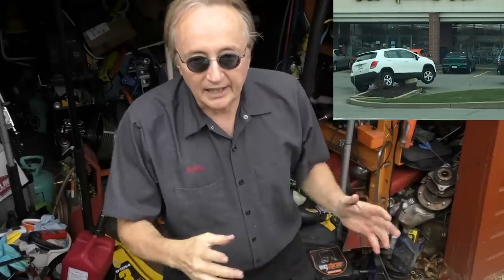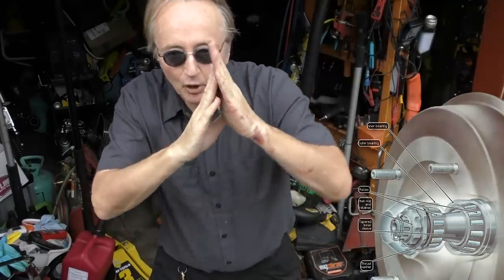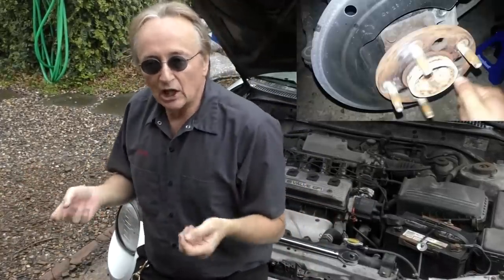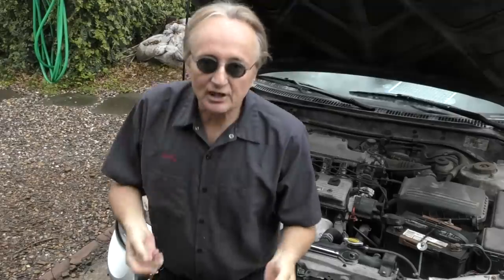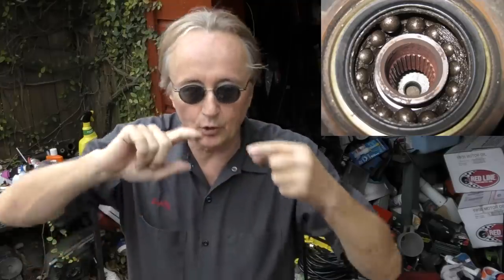Be careful where you're driving. If you hit curbs — maybe your wife hits curbs all the time — that little bump might not seem like much, but if it knocks the alignment off or slightly bends something, then instead of the wheel bearing sitting right it's got more pressure on one side or the other, and over time it'll wear out. Over the years I've seen this literally hundreds of times: a customer comes in, I can hear the wheel bearing roaring away, I'll say your wheel bearing is bad just on the one side, and they'll say yeah, last year the car got wrecked on that side. A little bit of damage was done to the suspension. It can take thousands and thousands of miles to wear out these steel ball bearings, but if they're off a little bit — think how many millions of times that thing is spinning while you're driving — eventually that little bit off is going to wear the metal and the wheel bearings will start making noise.